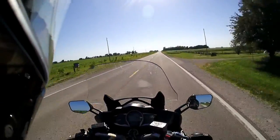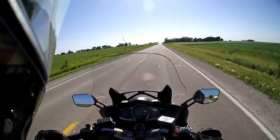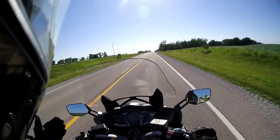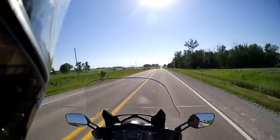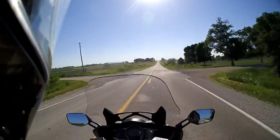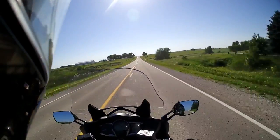And actually you can go into the deep settings on the bike, and there's basically 0 to 10, and you can tell the computer what percentage you want low to be. So if you want low to be just like 2, you can set that, and then medium you want to be 5 or 6 or 7, you set that, and then high usually would be 10. But you can change all that.